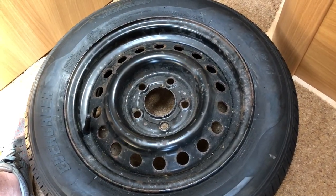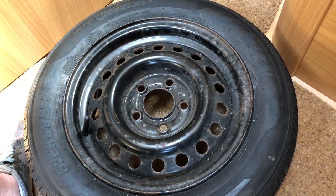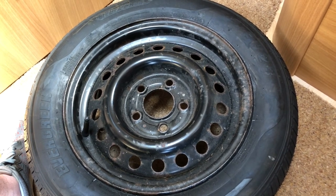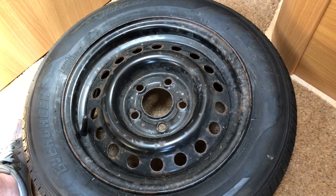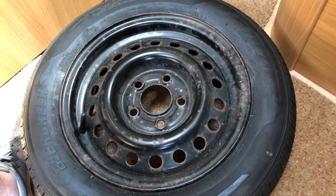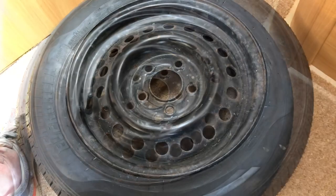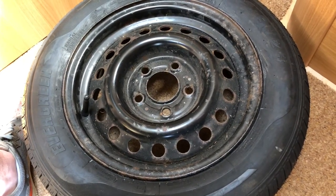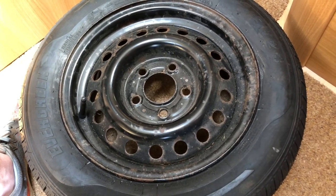What environmental conditions are a tire's enemy? Exposure to oxygen degrades the elastomer molecules, weakening the tire structure. Ultraviolet light also has a detrimental effect, and you shouldn't subject tires to mechanical stress. I've managed two out of three — but at eight years old, I think it's time for a change. The little Twitter chat has certainly prompted me into action, and I hope this video has given you food for thought too. Stay safe out there and we'll see you in the next one.